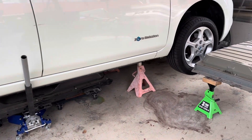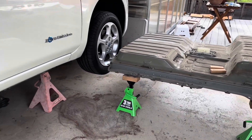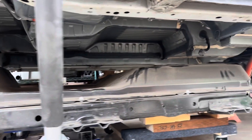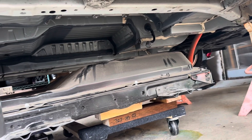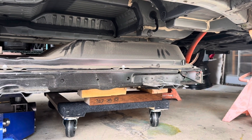We're getting ready to put the battery in. This is the one I took out of the white LEAF — it only has four bars. I've set it on these jack stands temporarily, and I will put it in the body-damaged silver LEAF. I've gotten both batteries out and got one battery back in a car. Doing it just on a motorcycle lift could be really hard to maneuver, so I got two furniture dollies which I blocked up, and I can actually move the battery quite easily that way — that's another tip.